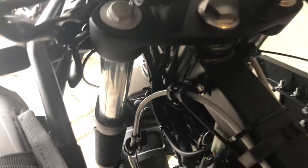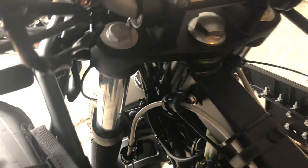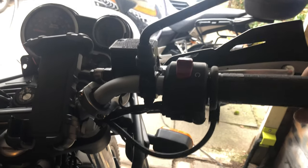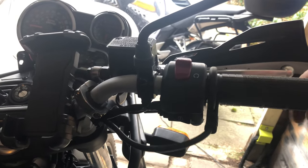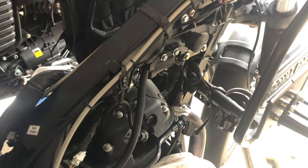A bit of tie-wrapping to get all these cables out of the way. You want to check for movement — see that cable flapping around? See if you can improve its position while you're there. Make sure nothing is catching and that cables can't get pinched by the bars or forks as they move. With the cables all routed and fastened up, the main thing to do before putting the bike back together is to ensure the throttle operates correctly. It's not uncommon to put these grips on and find the throttle isn't returning properly. Always worth checking before final reassembly.